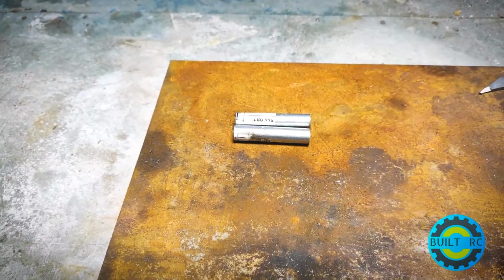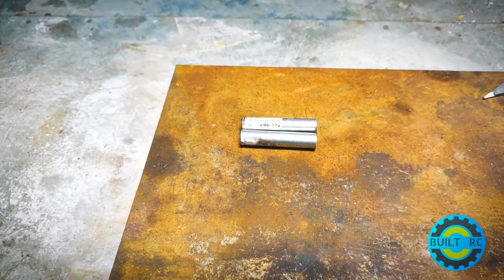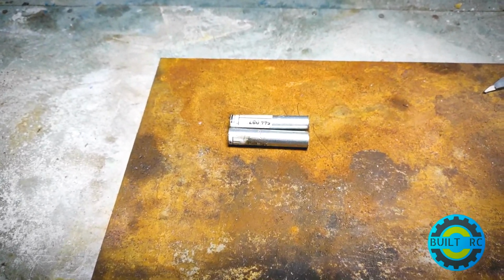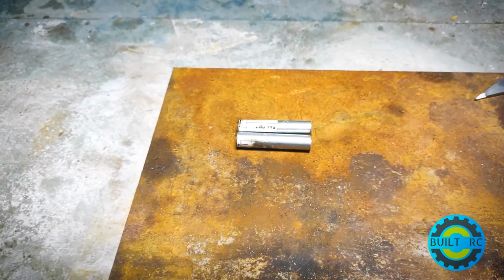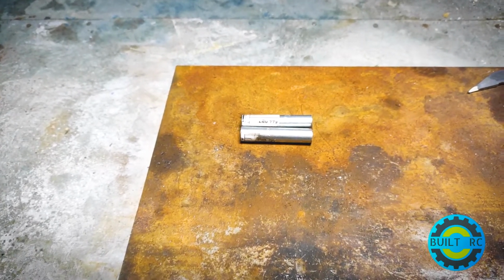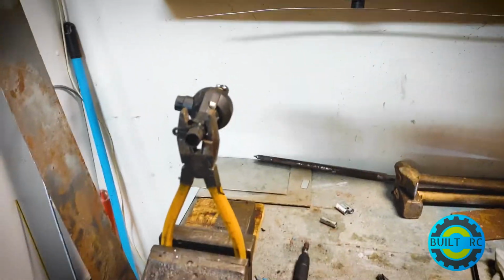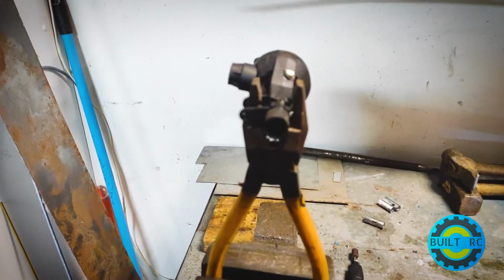Okay, guys, tubes are the length we need. It's like 51.5-52 millimeters. It will be enough. Next step is to drill the axle through. I will need to find some drill with appropriate size. I will inform you which size I used so you can do it the same way. Okay, I will proceed with the axle itself. Yes, I drilled the axle as I wanted. I used 10 millimeters drill bit,